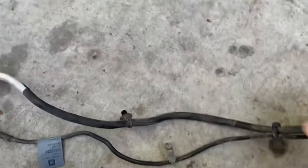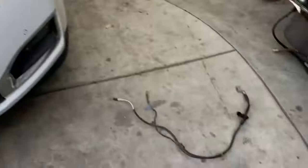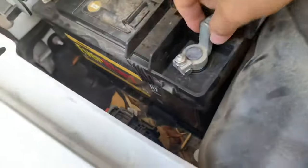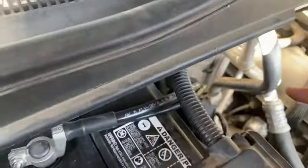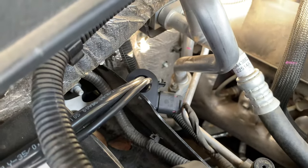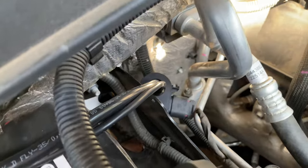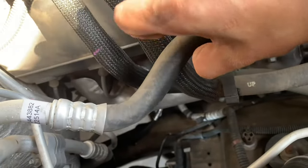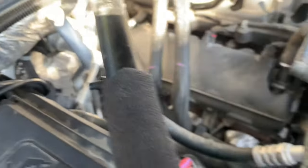Now you can get out of there. See, this is what I was talking about — this goes on top of the frame like that, it holds it in place. Just undo all these little fasteners with your hands stuck up under there, and that's it — you've got it out. Then just repeat the process. Put your new cable through — put your grounds first, or you can disconnect your positive and put that on; it doesn't matter. Just pass the cord through there and pay attention to where it goes, like through what lines it goes through, so you can have it as similar to how it was as possible. Connect this — you can see right there that's the ground cable going to the block. Just route it out through there, put the bolts back on, and that's it.